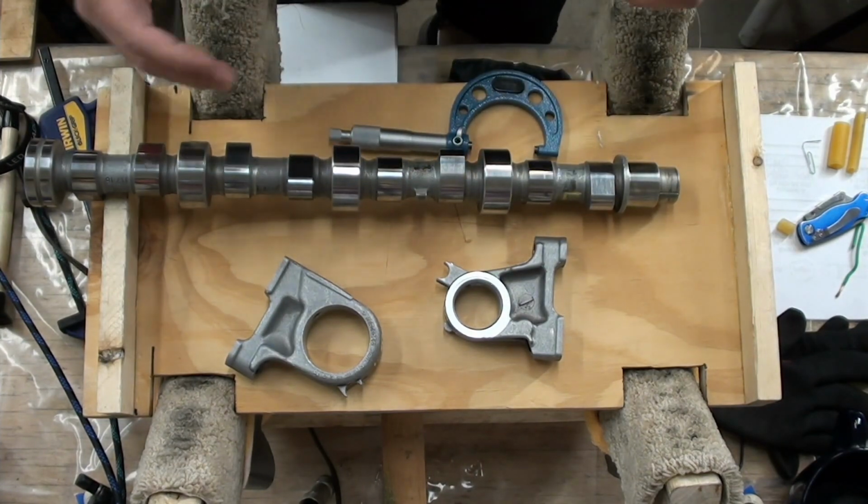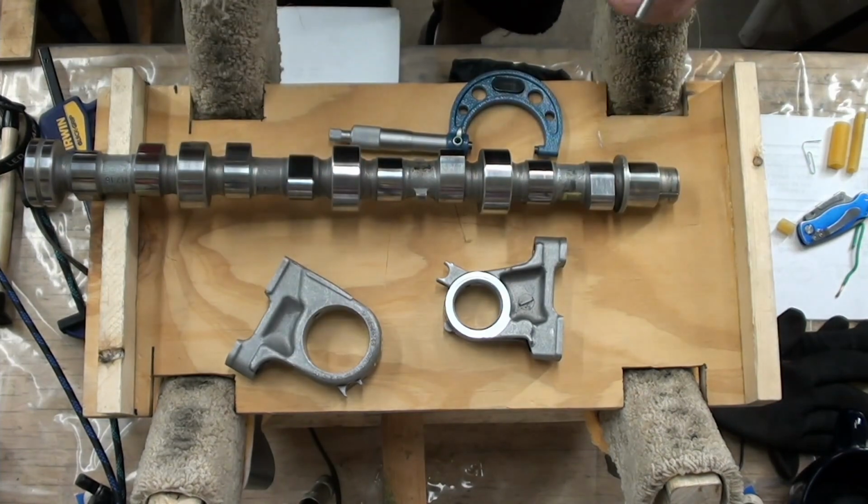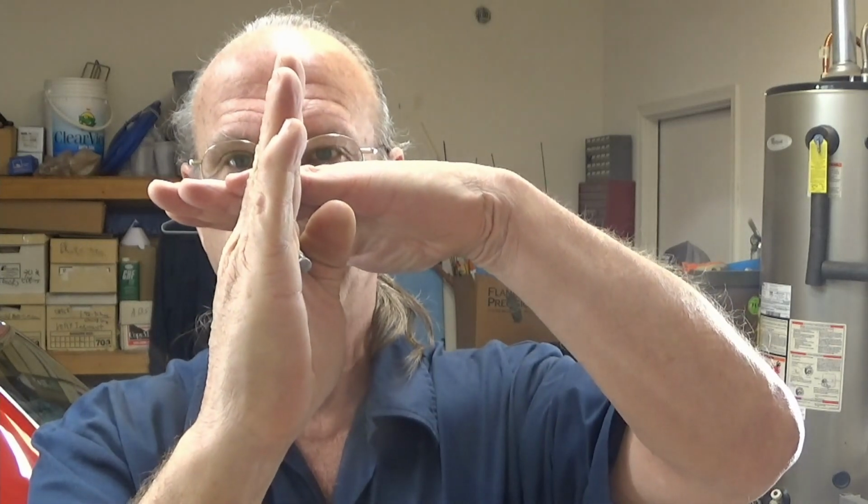All right, so now I'm just going to skip through this video a little bit. I don't know exactly how this video is going to come out because I have not edited it yet. I have a lot of footage. This takes several hours to really measure. It really did. I've got a lot of garbage video that there's no sense in uploading. I'm really just measuring these journals exactly the same way I measured the journals on our crankshaft. Here and here, right? And I'm also checking for taper or anything else you can. You just want to find what's going on.